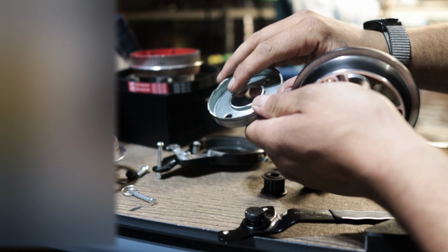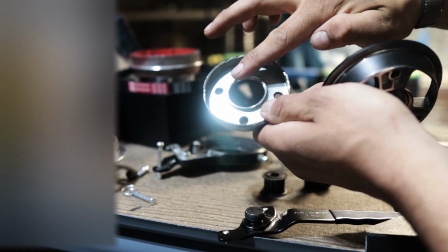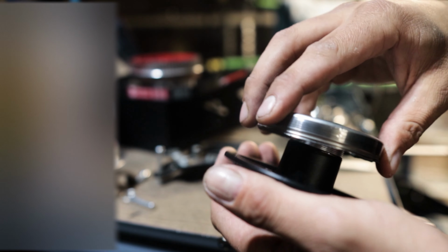So you're gonna need to cut this down so the threads are about 4 tall. Get in here with like a grinder or a Dremel or something like that, and grind this part down right here, so the threads are about 4 tall. And then you're gonna thread it onto your wheel, just like this. So you should be seeing your hub or your wheel kind of stick out right there. You put your spacer in there, it's going to be the smaller spacer, and then your brake assembly. There's no spacer on this side between this piece and your fork.